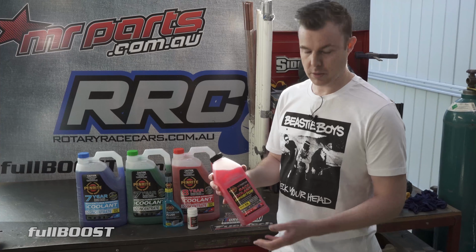And there it says, it's actually recommending 10/10 race coolant inhibitor, which is what we've got there, which is actually what we run in Project Redline. So this is actually a glycol-free coolant. So even though the green coolant is in there, Penrite are actually recommending this one, and it actually gives you the full capacity. So 13 to 17 litres capacity total, and a total flush is required. So this not only tells you what coolant to run, it tells you how much you need to buy, and also what the colours should be.